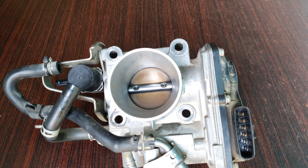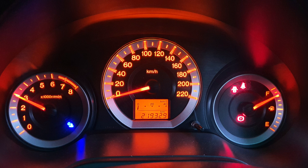Once clean, put everything back in the same order. When it comes to Honda throttle bodies, we need to calibrate it again so that it learns the idle position — the proper RPM resting position. If you do not do this, your idle RPM will be erratic, it will not be stable, and it may fluctuate even during driving. Every manufacturer is different, so do check with your manufacturer if such a procedure is needed.